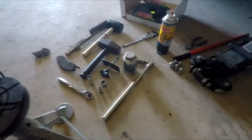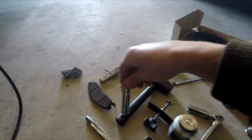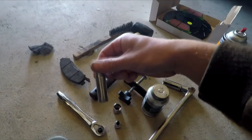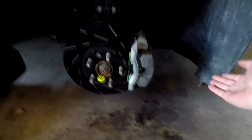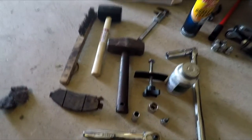For this Chevy Sonic, first you're going to need a 19mm to break off the lug nuts. Then you'll want to take off the caliper bolts — a 10mm does that. A 18mm takes off the caliper slide bolts on the back side. The caliper bracket is taken off by an 18mm as well. You'll want a jack stand under the car, and I use one to hold up the caliper so the brake line doesn't get messed up.